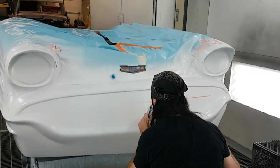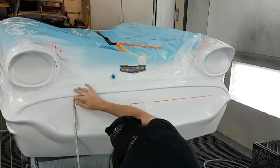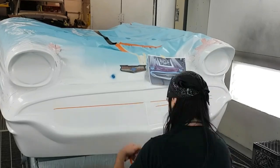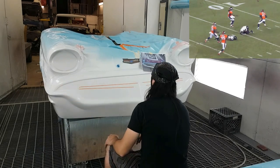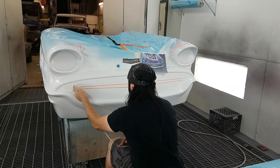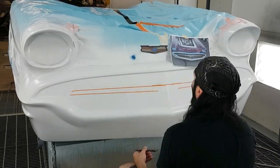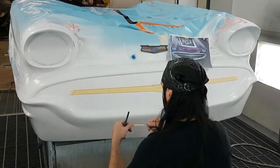With my eighth-inch pinstripe tape I am starting to map out the center bar that goes on this grill, and we're going to do this to save it and keep it nice and bright white while we tackle the interior of the grill. It's a process — it's always a process when you start having to get hard edges against hard edges with paint, and the best way I've found for the best edges is to mask and save.